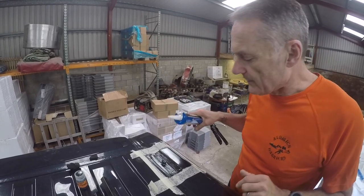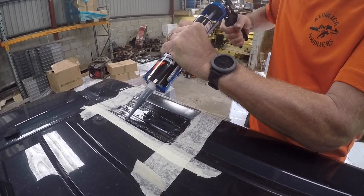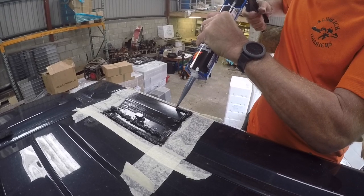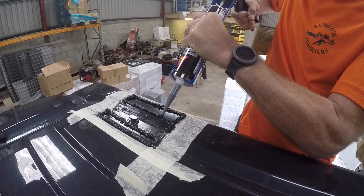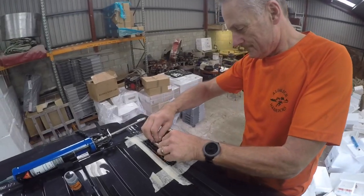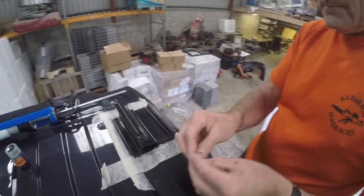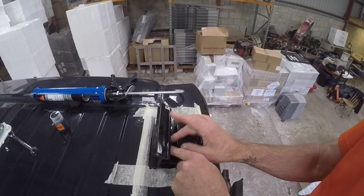Once the mastic has gone off the awning in theory will just clip perfectly into place and then can be tightened up. As you can see here I'm not being shy with this stuff — I would put as much on as you possibly can so that by the time you come to press down the bracket towards the roof you've got a cushion of at least three millimeters. In offering up the silver part of the bracket to the roof of the van, the open slot goes towards the outer edge of the van, and then you very carefully place the bracket down in line with the masking tape.